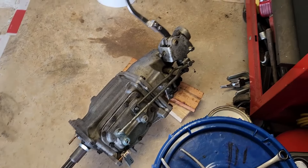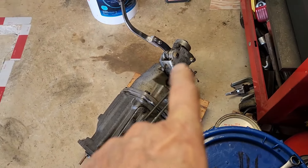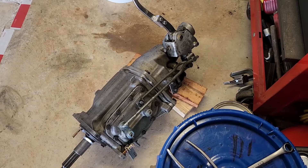I've gone and shifted it through the gears. Also I adjusted the backstops — those things there — which are adjusted in third and fourth gear for one turn off of zero clearance.